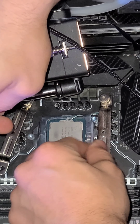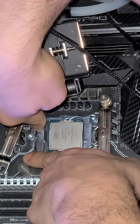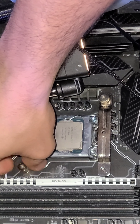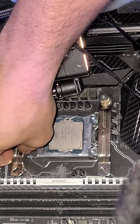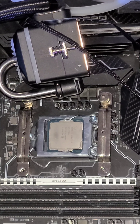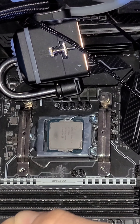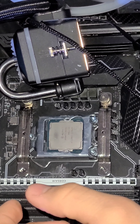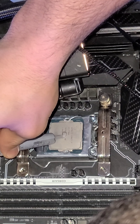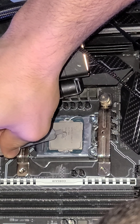Now I have my CPU here pointing down at the arrows. As you can see, there's a little white arrow — there will be some type of marker on your motherboard as well as on your CPU. Look, these two arrows are matching together to show where the CPU goes inside the housing. Gently place the CPU inside, being very careful with those pins. Slowly put the tab down, matching the lower-left tab inside the screw, then bring down the pin into the hole to lock down the CPU housing. That's how you install the CPU — fairly simple, but you have to be very gentle.